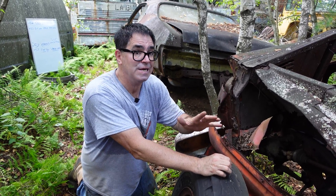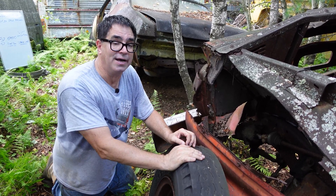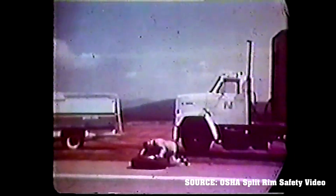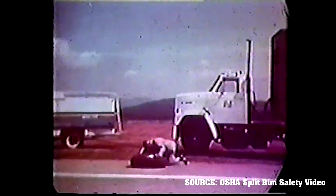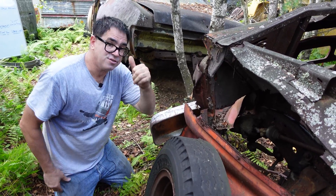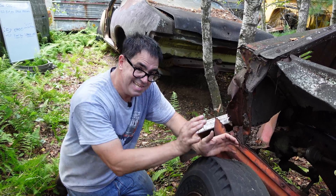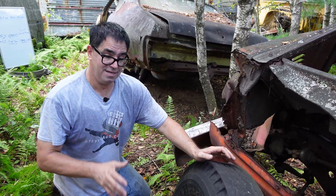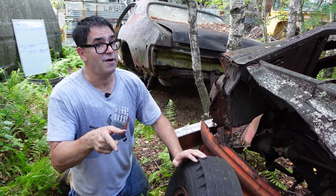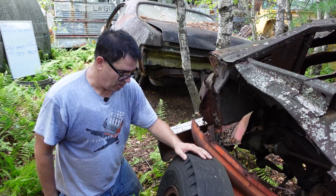When you inflate this to about 85 to 100 psi — these run at 85 psi, not 30, these are truck tires — you have 40,000 pounds or 20 tons of force ready to turn things into a jack-in-the-box, and people go through the room. The employee is in the greatest danger when inflating the tire. If the rim components are not assembled properly, air pressure can force the rim to blow out and strike a mechanic. This type of wheel is known as the Widowmaker — safe unless they're worn, rusted, or improperly assembled. Deflate the tire before you touch it. These have been known in inflated form to blow up randomly because of wear, rust, damage, or mixing and matching of parts. After 1974, OSHA and the DOT made these things very illegal — you can have them, but you just can't buy them new.